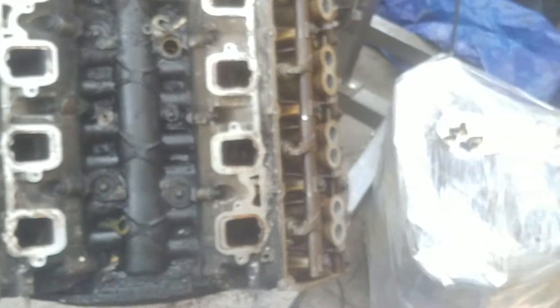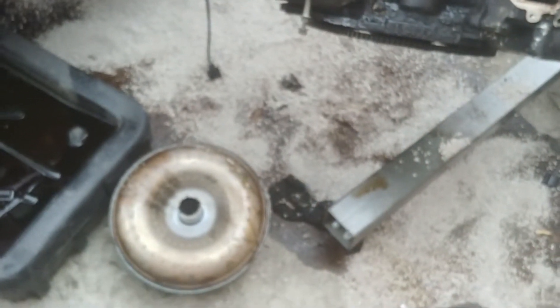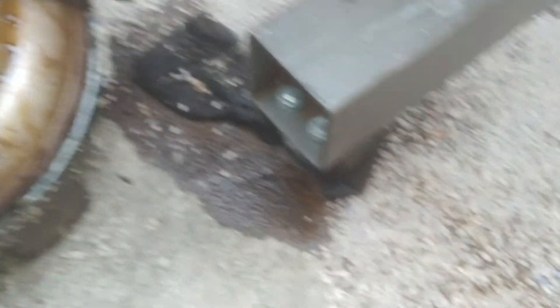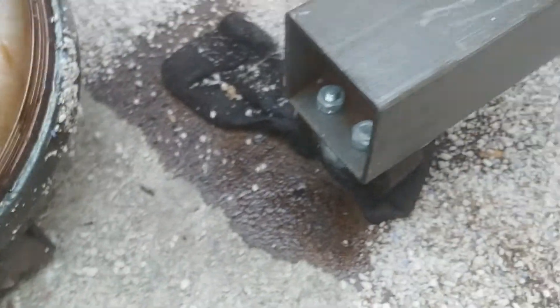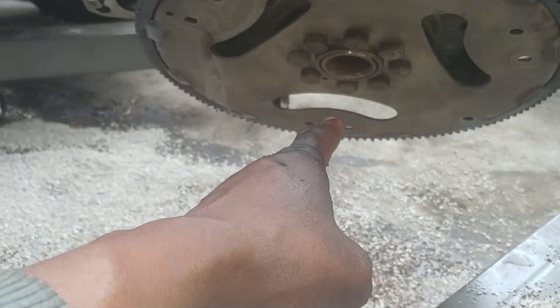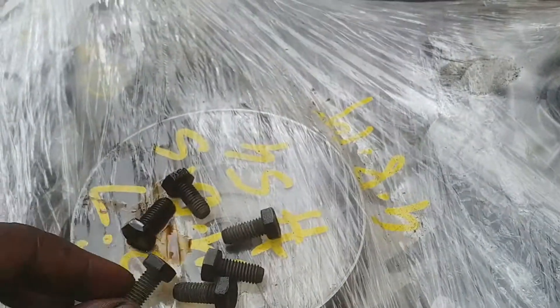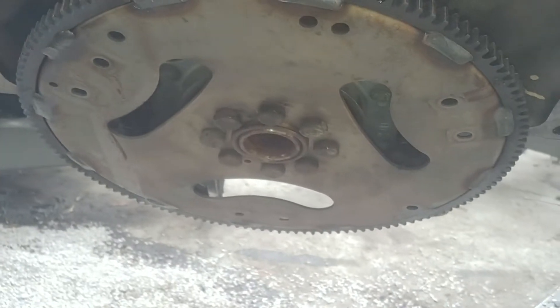In overall conclusion — turn the key, it's on — out with the old, in with the new. Now I've got to rebuild everything on the new motor. I've taken the torque converter off, which was a bit tricky. There are four bolts in the back that you can get to. In my situation I can't turn the motor, but those bolts are exposed down there. You can spin it with the crank and take them off — I forget the exact size but there are six of them total.